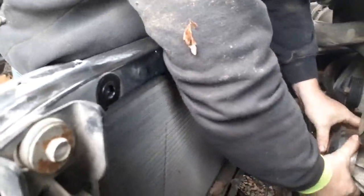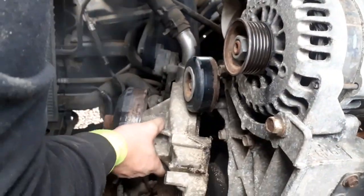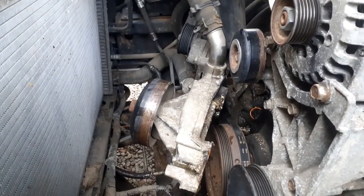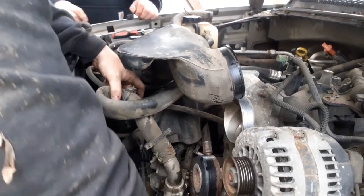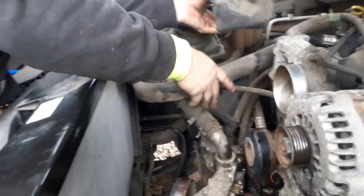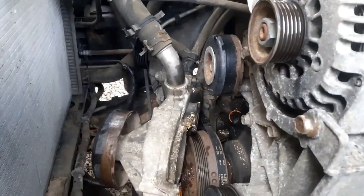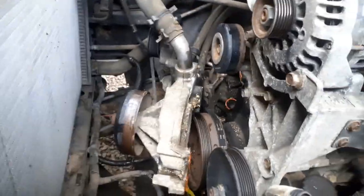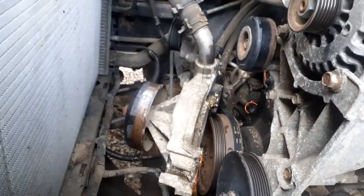He took the upper and lower shroud out, it looks like. He took the intake off. Now he's got the bolts out of the water pump - there's just two or three on each side, I believe. Yeah, you need to take that all the way off. I would have undone the lines from the pump itself, not just the radiator. Yeah, it looks like there were three on the passenger side and three on the driver's side, and then that just pulls right off. You don't gotta take all this accessory stuff off.